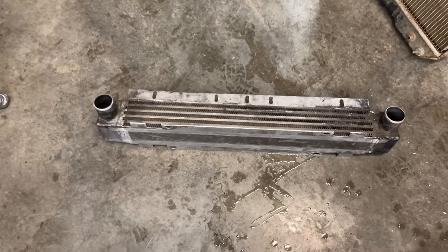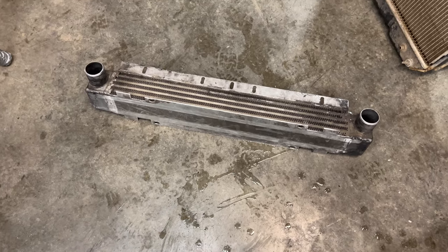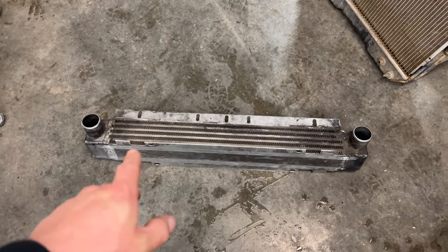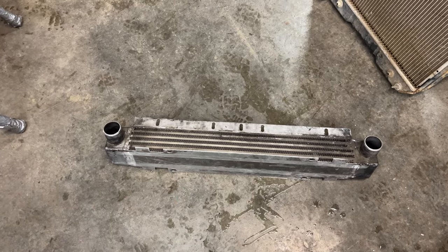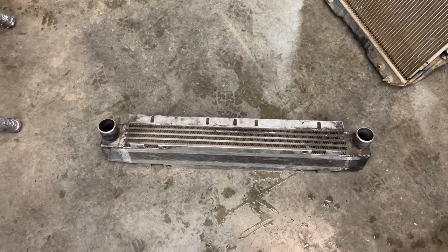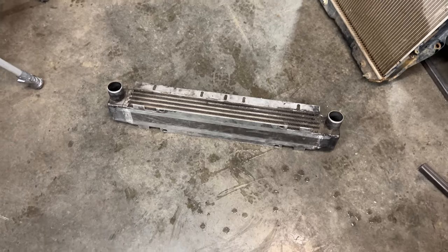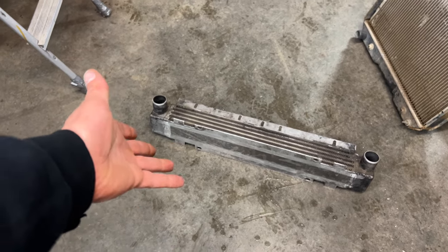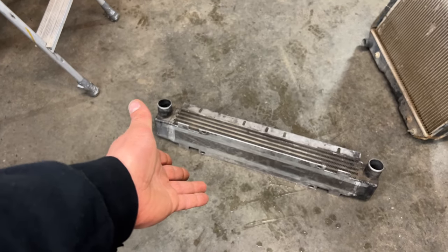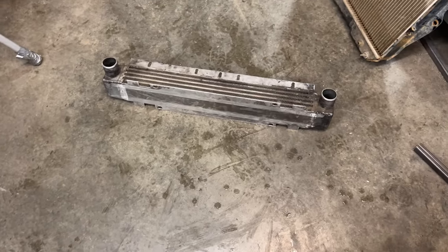Onto the intercooler — I've made a discovery. Here's the intercooler I was going to use. I was super excited because it actually came out of a forklift with a Volkswagen TDI — basically the same as an ALH out of a 2000 to 2003 Jetta or Golf, just an industrial version with a different engine code but same displacement. That was perfect — literally came off a TDI and was going onto a TDI — but it's far too wide.